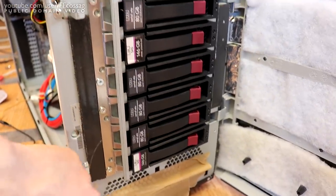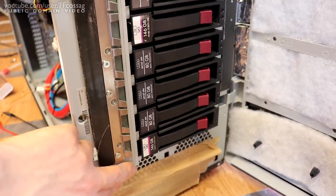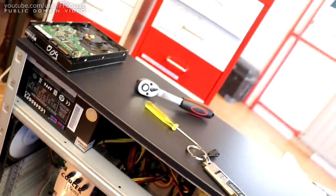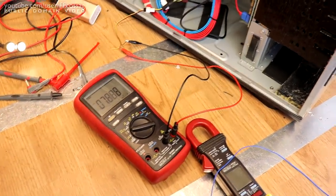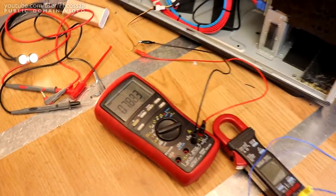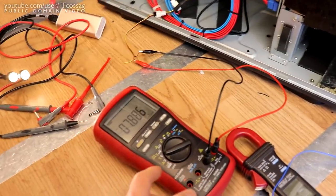I did leave the lower filter path slightly open since it does a lot of good for the CPU to have a bit of cooler air coming through. I just tested covering the entire front panel with a cloth to see how well the fan controller regulates with a clogged filter — it ramped up to about 8.5 volts, and now it's dropping back down with the airflow restored and the case side off. It did a good job.